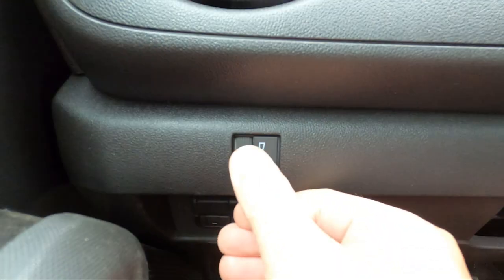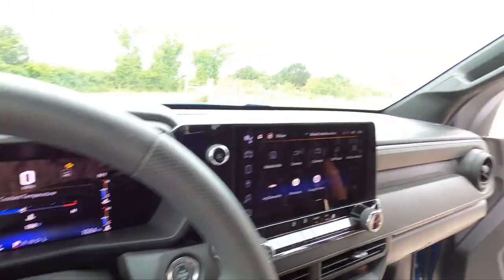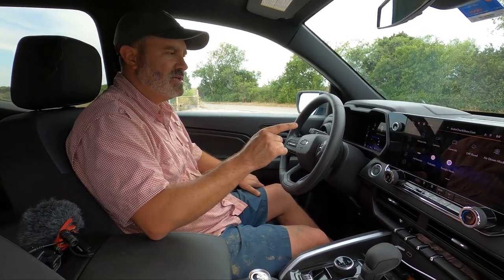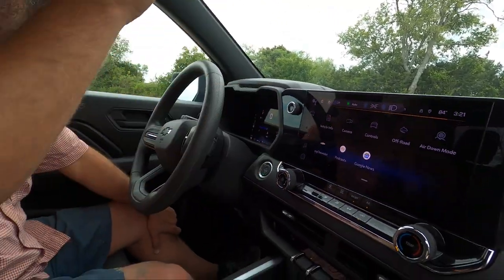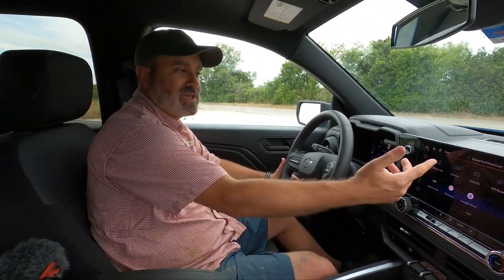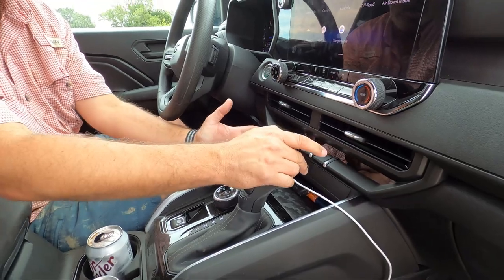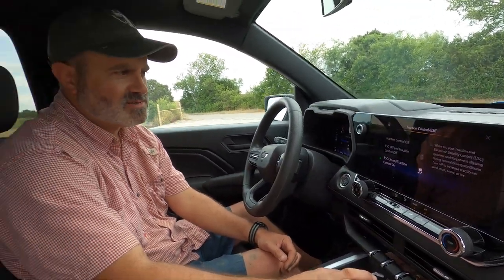You can adjust the instrument cluster brightness, which is nice at night. You get integrated trailer brake control — that's nice. There's no dedicated headlight button and no traction-off button. However, Chevy put the headlight control right at the top of the screen no matter what screen you're in — it's always a hot key in the same spot. The auto headlights mostly solve the problem, and it prompts you when you leave park. For traction control, you go to the truck icon, then drive and park — traction control — and you can pick which setting you want. It's a few extra steps but it's still there.